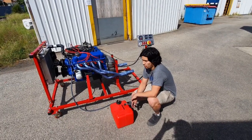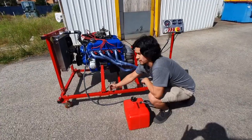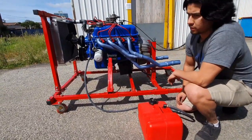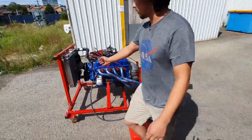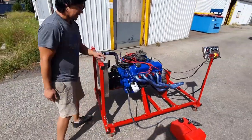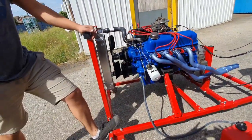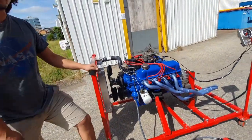When we set up this motor, we moved the telescoping pipe up and down to suit, and we made sure we allowed enough space between our 3-core radiator and our fan. Everything on this particular stand is adjustable, so it's just a matter of figuring out what's best suited to your application.